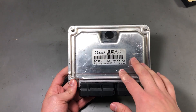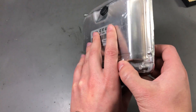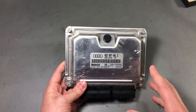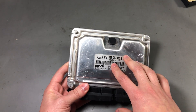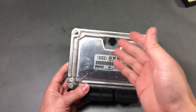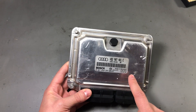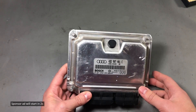I've never opened one of these up, but we should find something interesting to see in here — at least from the point of view of construction methods. These things need to run smoothly even in the hardest conditions, like very hot or very cold weather, while enduring water pouring right onto them and withstanding high levels of mechanical shock and vibrations. So it's likely we will see a nice seal on the enclosure, as well as conformal coating on the PCB we find inside, and maybe some special assembly techniques to improve reliability.